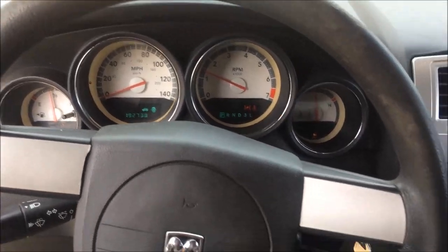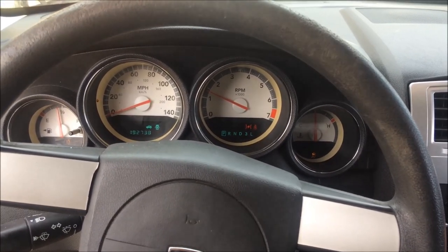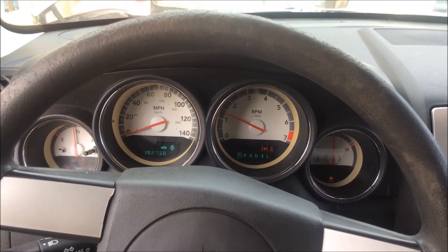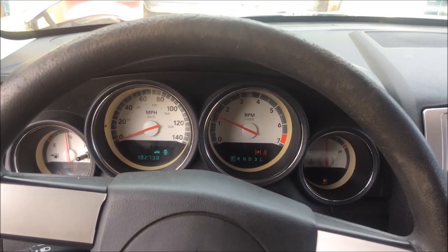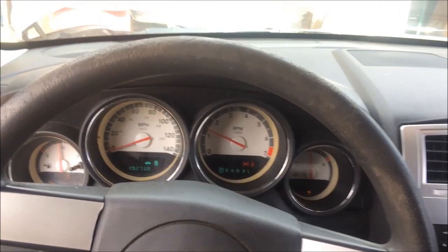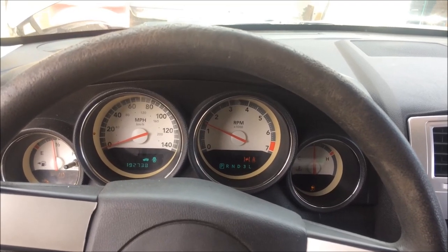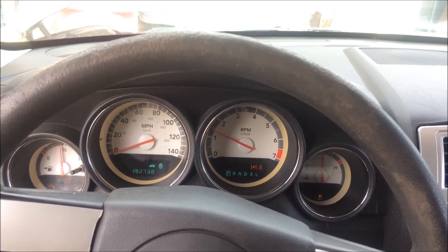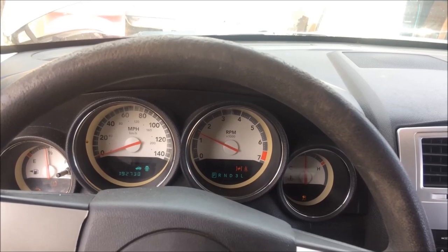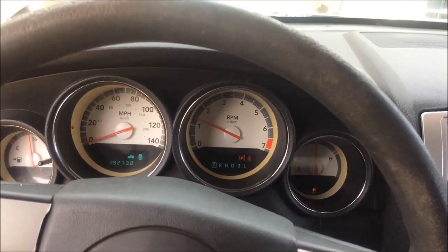So you're getting codes like multiple misfires, misfire in cylinder one, idle air control motor issue codes — anything like that. I can post numbers in the comments below or in the info box below the video to give you specific numbers. I got six different codes on this one alone. This is the easiest fix. We actually did a tune-up on this and it was doing this before, but I ended up plugging that thing in good enough where I knew it wouldn't come undone. But I must have broke the safety clip in the process, to where it will work itself loose as you're idling or you go and accelerate — the clip will work itself loose and you'll have these problems.